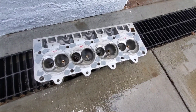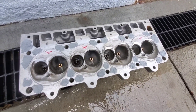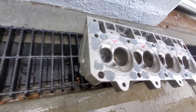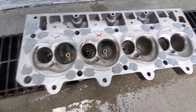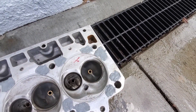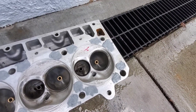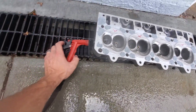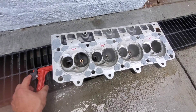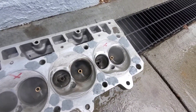I had already planned on putting epoxy in the block — I definitely wasn't going to weld the block up — so I just put epoxy everywhere and I think it'll hold pretty good. Got both heads done and the sugar is washed out from underneath all the epoxy. I drilled and tapped a fitting in the back of the head, and all the surface of the deck is completely sealed up except for that front hole, which will be the feed hole that comes in from the block. I put a water hose in the hole in the back of the head and as you can see, there's no water coming out of the surface of the deck — just out of that front hole.